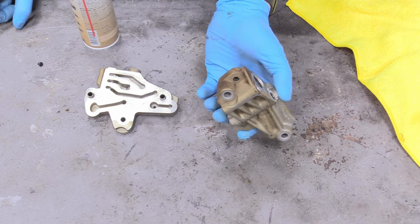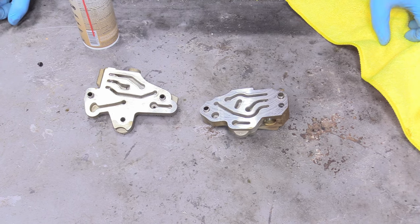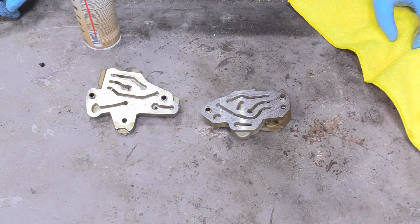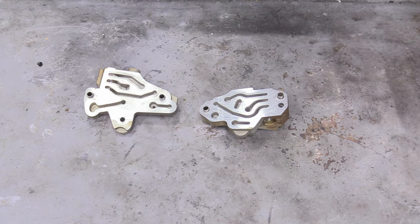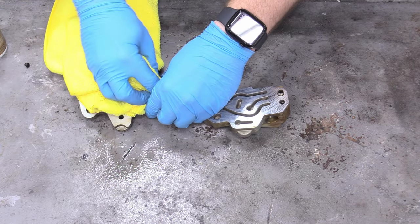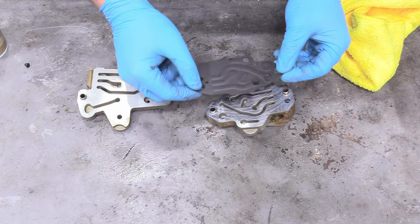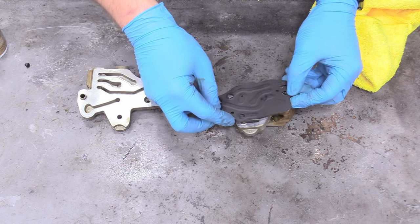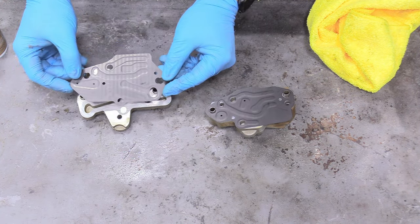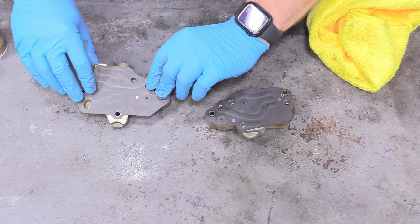Here are my oil control solenoid housings. I have reconditioned mine — there's a little screen in there that I took out and cleaned off camera. It's a little tricky and kind of an advanced thing, but if you feel comfortable doing it, I implore you to try. However they're not terribly expensive and I do recommend just getting new ones — I'll try to leave a link in the description. What we can do is clean the mating surface of them and make sure they're very clean because we want this to seal really well. Then grab our gaskets that came in our Fel-Pro gasket kit — they only go on one way so you can't actually get it wrong. Just flip it around until you figure out where it wants to go.